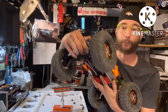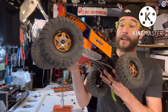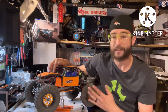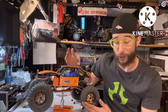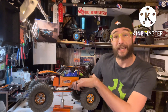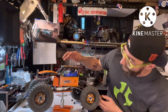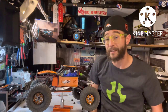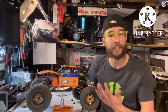And we got everything here. Capra front axle, Capra rear axle. Took it to work and knocked out some quick little aluminum sliders just to make sure everything's nice, tight, and tucked up in there. Now, as far as trimming, I've seen some of these Capra cages on the LCG chassis where they're chopped. I didn't do an aggressive chop on it yet. Keyword is yet. I'm thinking about taking it the rest of the way at the angles just to open it up a little bit more. But honestly, even at full compression, the bottom of the links are just at the bottom of the door, so nothing's hanging down too much to hinder anything. But we'll drive a little bit more, see if we do need to trim that and open it up.